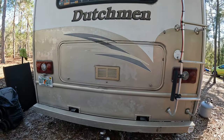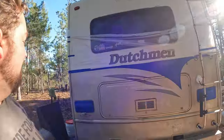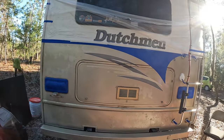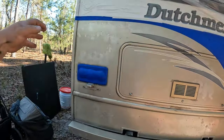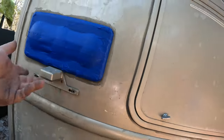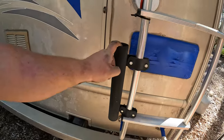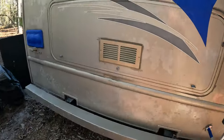Took a little while but just about everything I want taped up is done. I put some plastic up top to cover it in case of overspray or wind. I covered up the lights and the light bulb under here because I'm going to have this blend in. I wrapped up the wire around here, and now I'm going to sand this all down, wipe it down, and then start spraying.